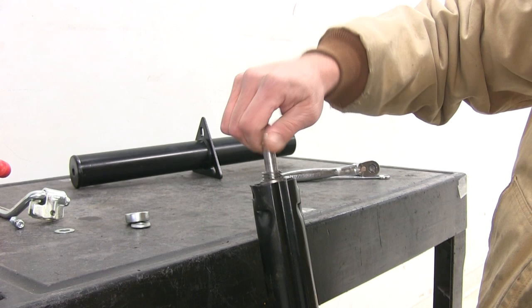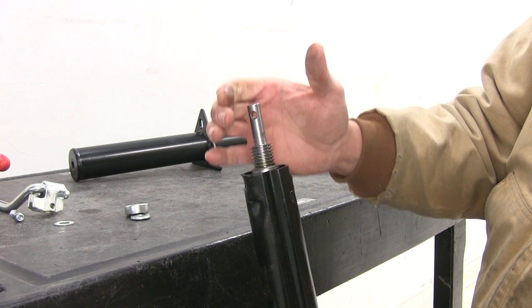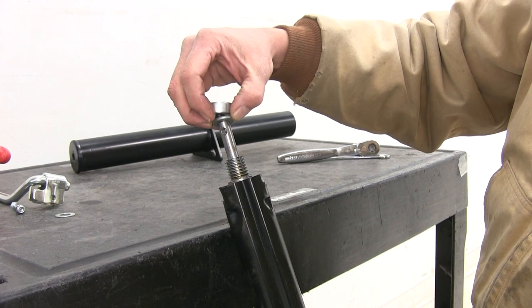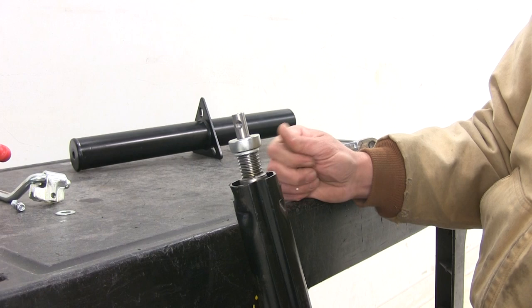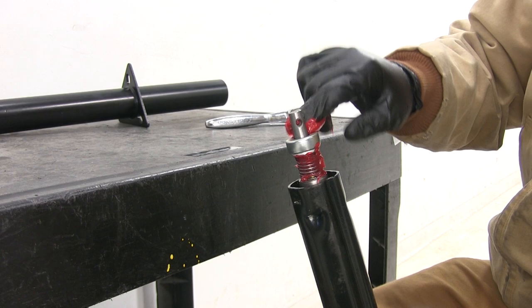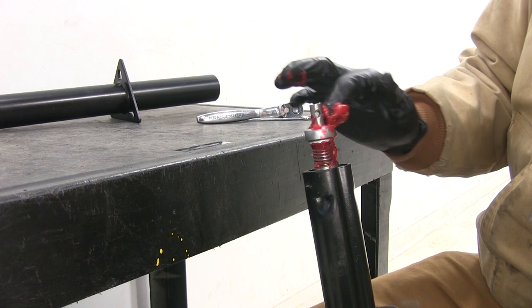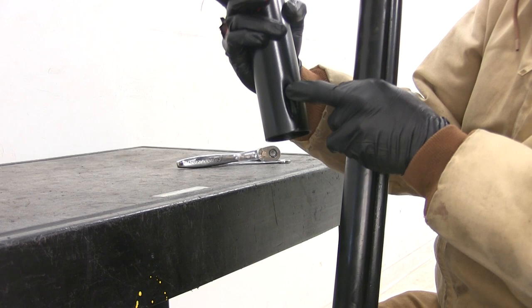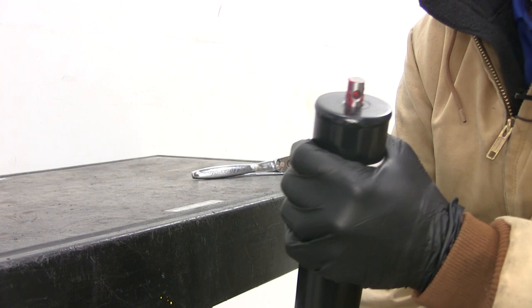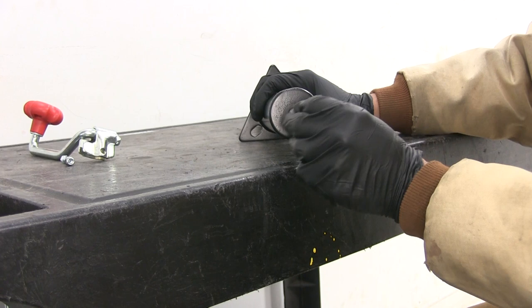It's just a real simple mechanism — we've got a machine style screw here that's going to force that jack leg down as we turn our handle. This part is very very tough to actually mess up; the part we tend to see failure in is going to be either the bearing or the handle assembly itself. So we'll put that right back down on there, and I like to use just a little bit of grease to get it down on here. If you're rebuilding it, it never hurts to have a little bit of extra lubricant — that should help us out. You'll see a small groove in the outer tube and a groove that will run the full length of the inner tube — you want to be sure you line those up as you slide it back together. Then that'll come right out of the top, and you'll want to place your washer back on, the handle back on, and reinstall our bolt.